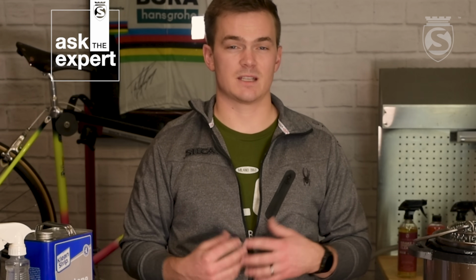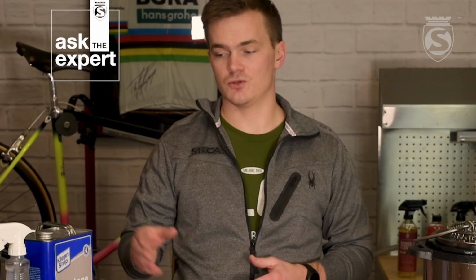And then about every 250 to 300 miles for a hot wax. Typically, I like to go about every 1,000 miles and I will hot wax, and do Super Secret about every 200 in between, so I'm not taking off the chain every time I need to relube the chain. The maintenance for either is really the same though.